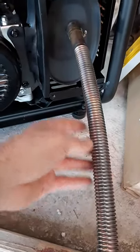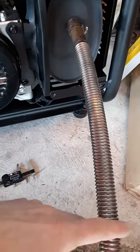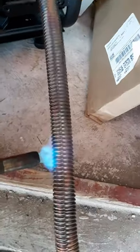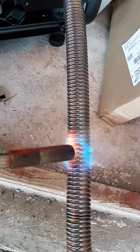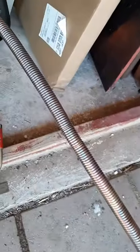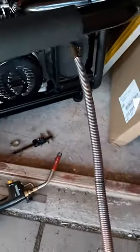After running it for four hours inside, the oils were burning off and it was really stinky inside the garage. Running it for six or seven hours outside didn't do much either. I recommend everyone take a torch and just warm it up — torch that stuff off before installation. Go outside and do that; you're going to save yourself from breathing it and making your garage stink for days.